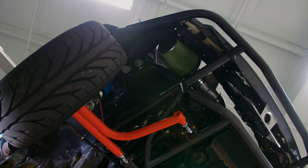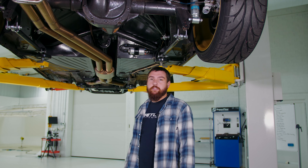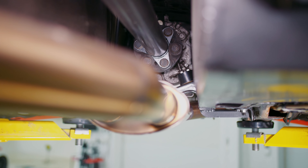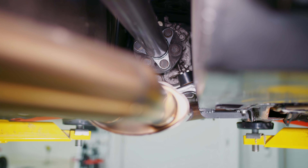Underneath there's a bunch of ducting. Last time I had the front section done but not the exit ducting — this seals up against the back of the deck lid to keep hot air away from me inside the car. It comes out easily and reveals the fuel cell underneath and the CSF radiator from a Jeep XJ. Everything under the car is fully welded and painted now — last time it was bare metal and tacked together. I've got protection for the oil pan; this bar hangs just as low as the pan, so hopefully I don't take the oil pan out. The control arms are powder-coated and look great.